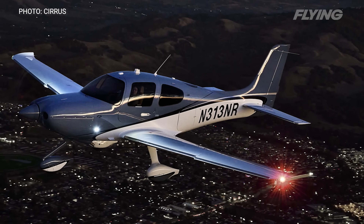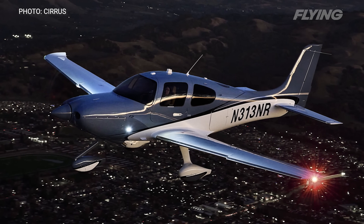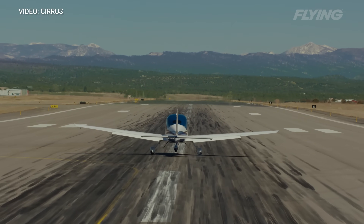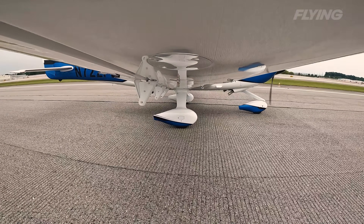The servos bring the power all the way back, deploy the flaps to 50%, and configure for a 95-knot approach speed to the end of the runway. At approximately 60 feet above the runway, the power comes all the way back and the plane starts configuring for the landing. It descends to about 50 feet above the runway, flies the flare using the radar altimeter to determine exactly how far it is from the runway, bleeds off the airspeed, and touches the mains right down on the runway. As soon as it touches down, the flaps retract and the Safe Return emergency auto land braking system engages. The brakes are applied evenly, and when the aircraft comes to a complete stop, the fuel pump is shut off, the mixture automatically retracts to zero, and the engine is shut off.